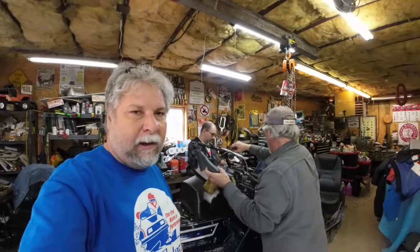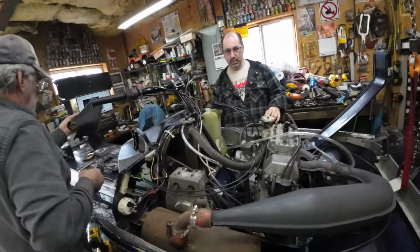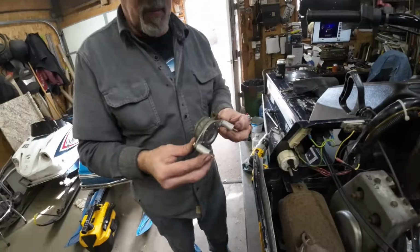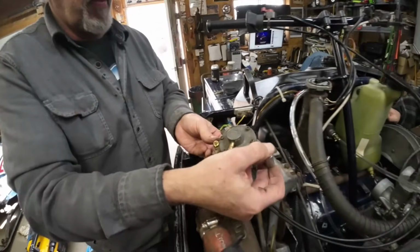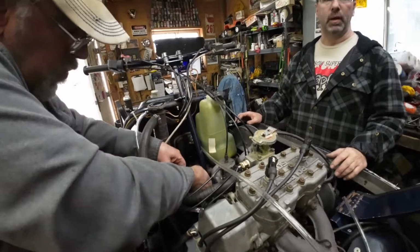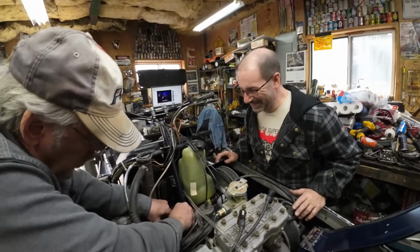All right, we're back with the big update. We've done all kinds of things. So you can see there's a bunch more lines getting started to route, and we've invented some fuel pump standoffs for Tommy. That was a quick little lathe job. We made them 1 1/4 inch, so the line will be up above the jack shaft. Patent pending on that invention. I don't think so, since TX came with them originally.